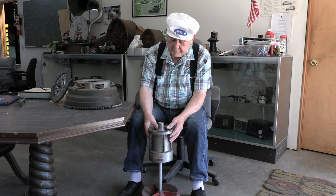because once you drill, you may find out, oh, I should have moved that a little bit. You know, maybe you're just not quite square with where the weights were, and so you can then do it more than once. In fact, you'll notice on here a lot of flywheels are drilled in more than one place. So they drill it, test it until they get it right. So you may not get it exactly right the first time. Now that's balancing the flywheel.